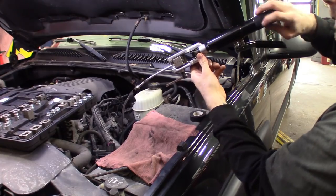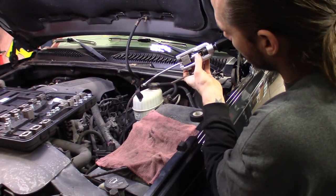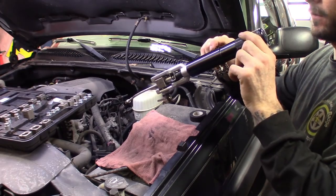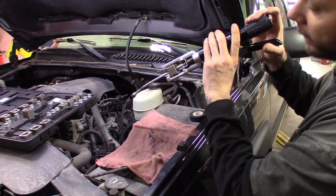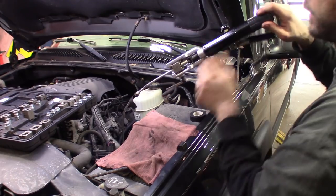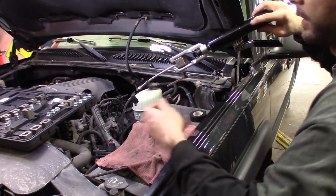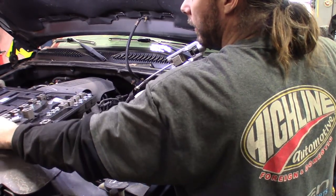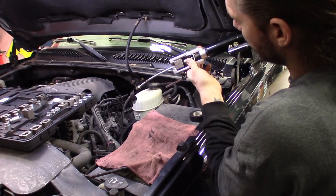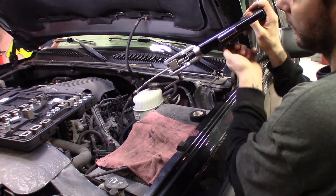This piece unscrews — get your first one, this will do your first flare. Pop it into the little guide, screw it in, close off the hydraulic pump, and then just pump it a few times, push it all the way down until it stops. Done — release the pressure. That'll be our first flare. Don't need that one anymore. Grab the cone one — this would be our second flare, hence double flare. Screw that in until it touches the line, close it off, get a few squeezes of the trigger, and that's it.